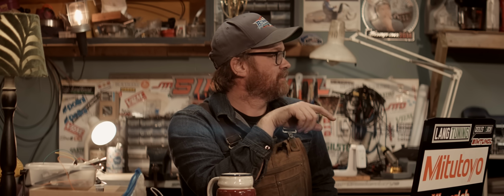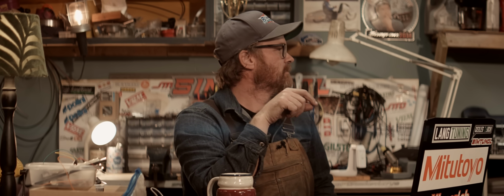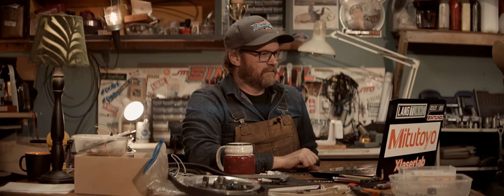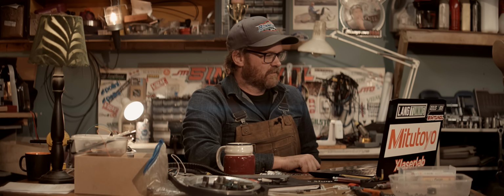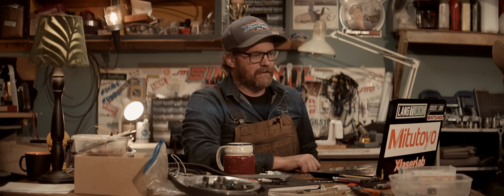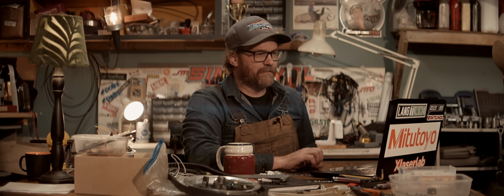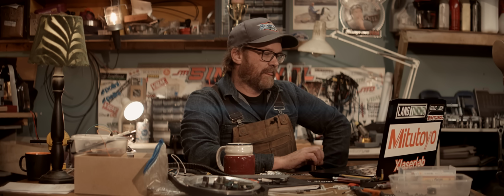It's on methanol and nitro, there's more in there. We need to give it even more fuel. I don't want to destroy the engine today. Tomorrow I might, but now I want to... This is 30 at the crank. 30 horsepower at the crank. Probably more. 29.75 measured at that sprocket, output sprocket.